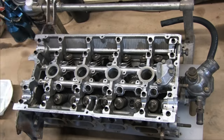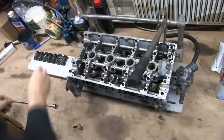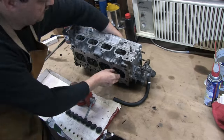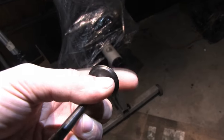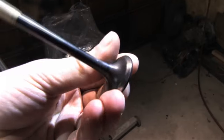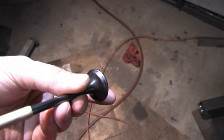During assembly, in the last video, I took the Hyundai's head apart to clean out the valve guides and other parts that were contaminated when the old rod bearings failed. I found a lot more wear and tear in it than I did in earlier inspections, and I'm really glad I took it apart. The worst thing I found was 7 bad exhaust valves, crispy critters with pitted up faces. Clearly they're not sealing like they should, and I've done an awful lot of work to make the bottom half of this engine right, so I can't bring myself to bolt it back down without fixing that issue first.